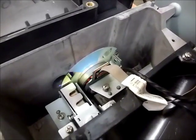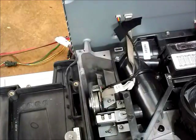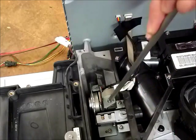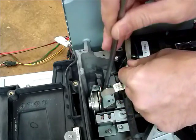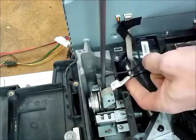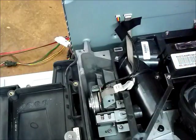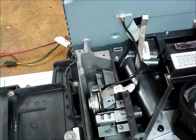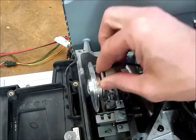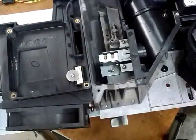We're going to talk about cleaning that haze from the color wheel, and most importantly about preventing future haze buildup. We'll start by removing the color wheel from the set — there are two screws. The second one is down low and kind of hard to access. Nothing holds these cables in; they're just loose, so you don't have to worry about damaging them. Remove the two screws — the color wheel is loose now. Remove the two connectors from the DMD board and the color wheel will just lift out. Be very careful not to damage the glass.